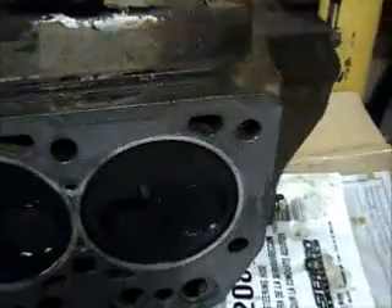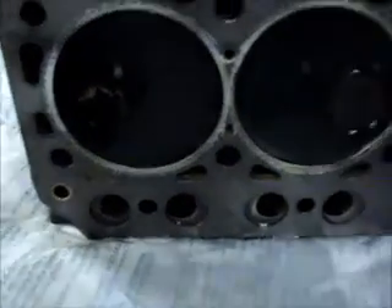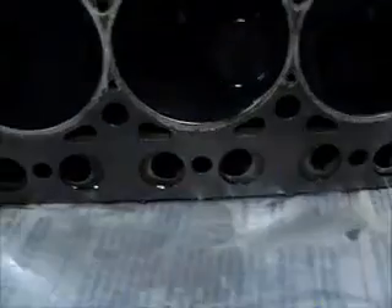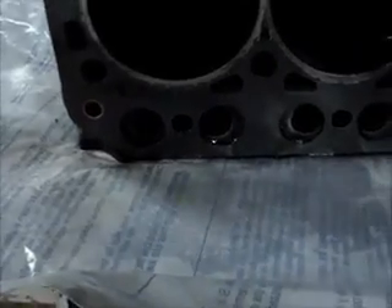Haven't a clue. But here's the head — as y'all can see it's still in good shape. Mine is missing just a little bit around there but no issues with it, which is good. Which is awkward because this thing has no dowel pins to hold the head in place at all.